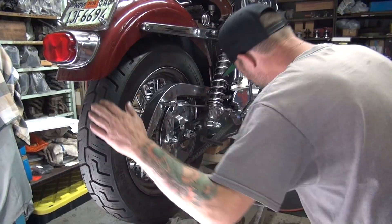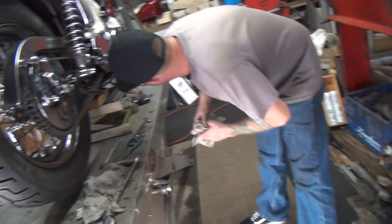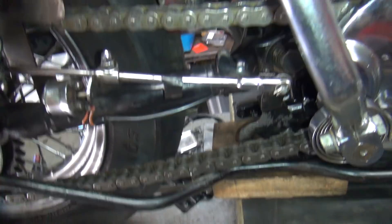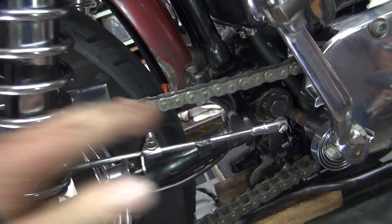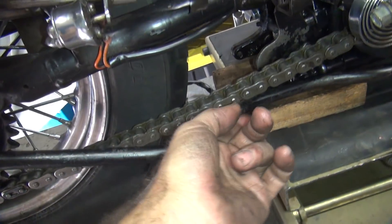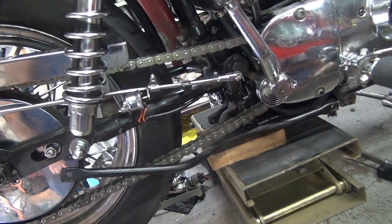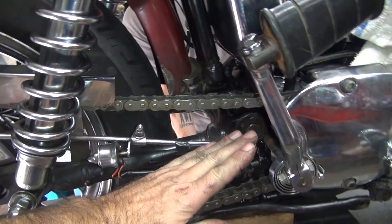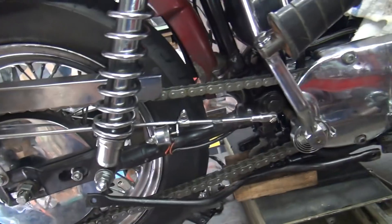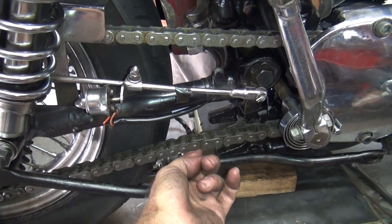How's the chain clearing? Find a tight spot. If you rotate it and watch the chain go up and down — when it goes all the way up, that's a tight spot. It's got a tight spot right here. So I dropped the bike down to see how much it changes. This swing arm is going downhill, so it changes a lot. When the swing arm is flat, that's when the chain's long — that's where we have the most difference between the centers. So now we just lost about half our clearance.